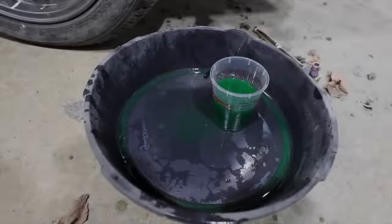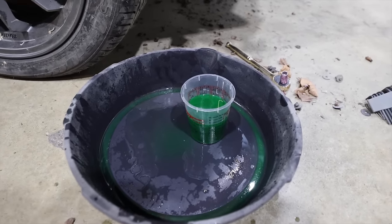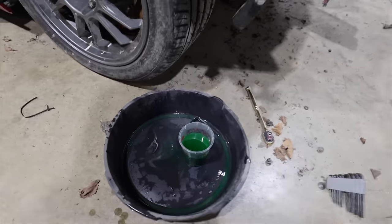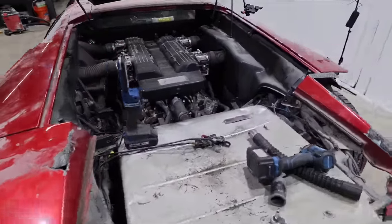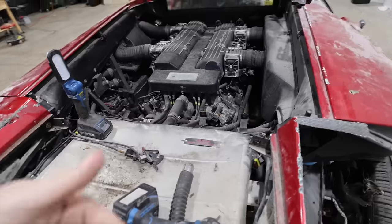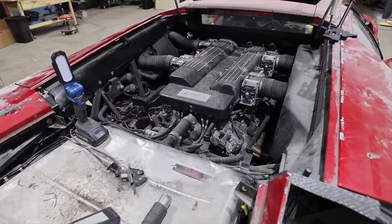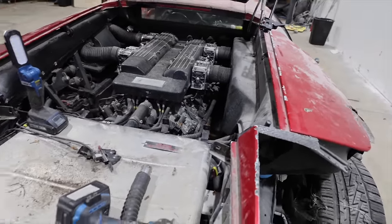Okay, real quick, coolant looks great. So we're gonna add coolant, maybe flush a little bit of coolant. It's kind of hard because the questionable side is the one that doesn't even have a radiator. So we'll run some water through the system. Really, a lot of what we're trying to do is make sure that there isn't any big giant debris in the system, which we've already ran this car, so it kind of would have ran through. And then the other thing is we want to keep the water pump wet, because if you run them really dry, it can damage them. It doesn't often damage them, but everything's so expensive on this car, we don't want to risk it. So we'll get some fluids in there.